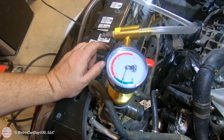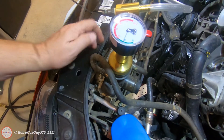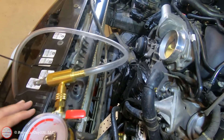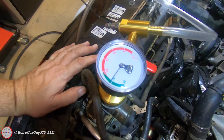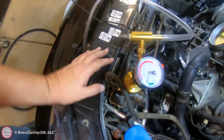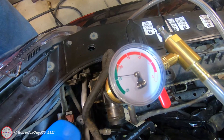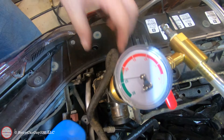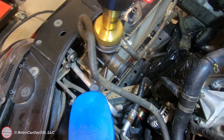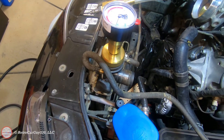I'm doing a leak check with my AirLift vacuum checker for the cooling system and vacuum quick-fill. I've got the old hose on here with the clamp and stoppers in on the top and bottom. I did a vacuum pull on this — it's right at just above the 25 mark — and I'm going to see if it loses any vacuum. As you can see in this video, it did drop a little bit. So I was questioning the quality of the radiator at this point. I pulled the radiator and ended up choosing a different test approach by moving the test tool to the upper radiator hose nipple area and then sealing off the top part. That ended up working — so it's actually a good radiator and fix. It's just this test approach was not the best one.